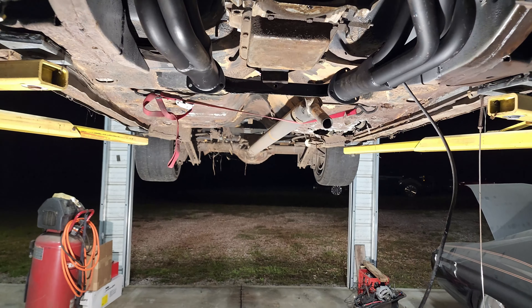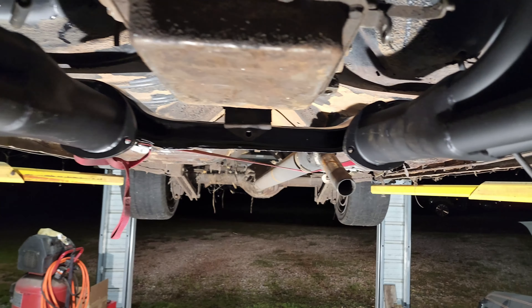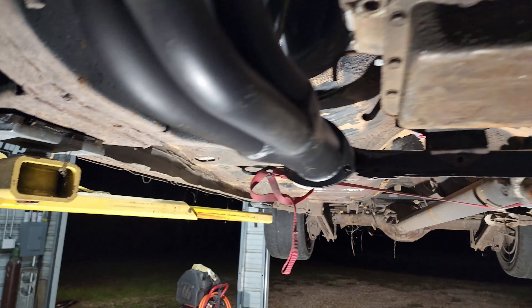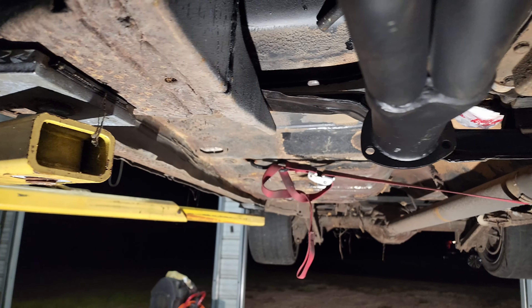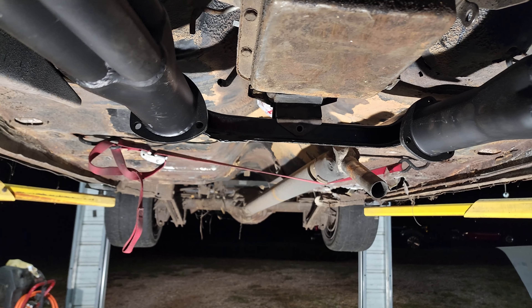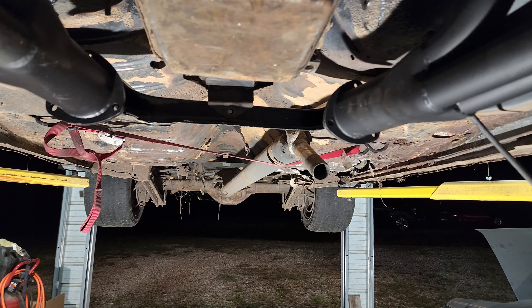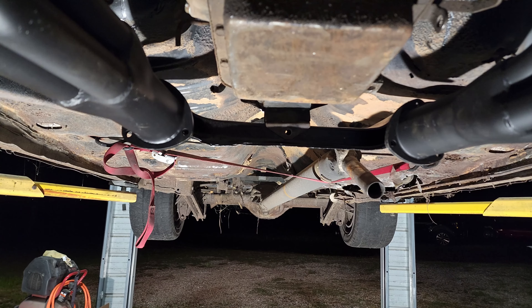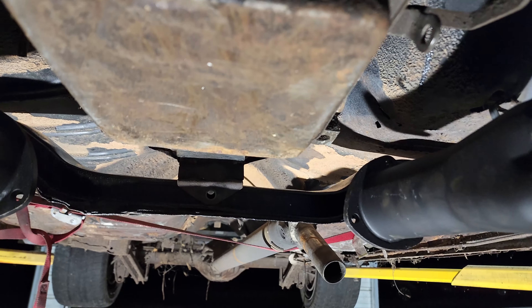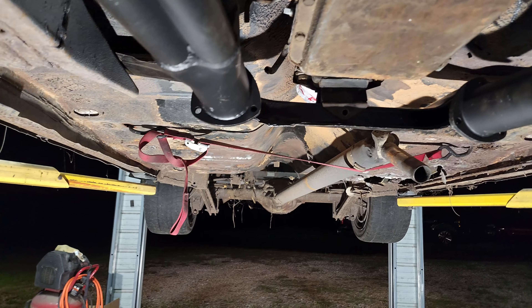You can see my dilemma with the headers as well as the cross members right there. I've got possibly something that's going to work — it'll be in sometime this week. If it works, cool; if not, I may modify and do a different thing or switch headers. I haven't decided. The actual suspension turn lock to lock is not a worry — it's just the clearance with the trans I'm dealing with, which is my fault. I could get headers that I know fit for this vehicle, but these were Mustang headers and I created this problem. Trans cross members should be able to fix it so I don't have to deal with the clearance issue. The reducers are going to be 2.5-inch reducers from the three-inch headers all the way back, so I should be able to clear with a few modifications.